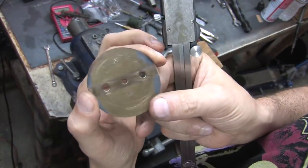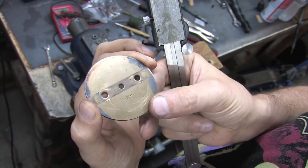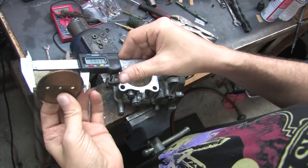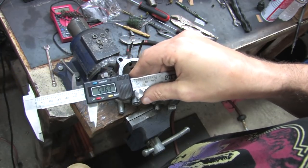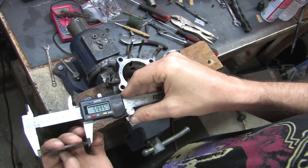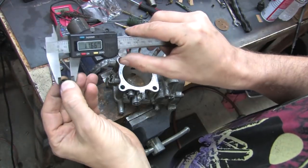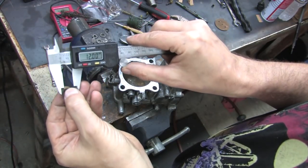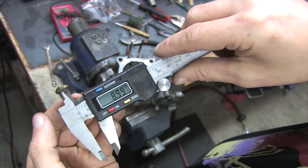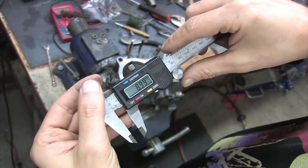Here's the 90 throttle plate, and you'll see that it's stamped with a 50. It measures 2.5mm thick. Across the flat edge on it, it measures 59.69mm, and across the fat edge, it measures 60mm. There's the outer diameter of the small seal, 12mm. The inner diameter is supposed to be 8mm, but we won't get that here. The shaft it seals against is 8mm.